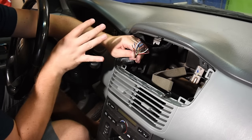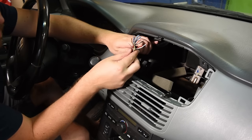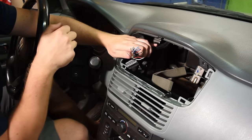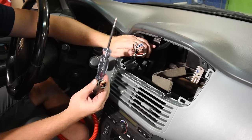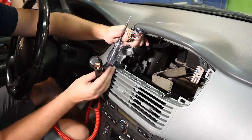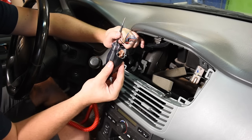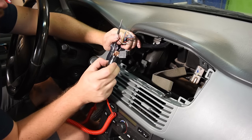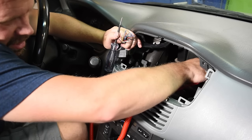If your car harness has been cut and all you have is bare wires, you've got to determine which wire is which to properly wire this up. Start by determining your power wires — to do this you need a test light or multimeter. I prefer the test light because it's easier and quicker. Hook the clip end to bare metal somewhere that will make a good ground connection.